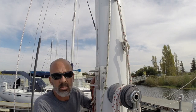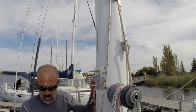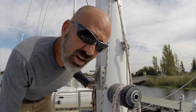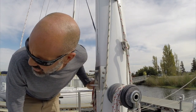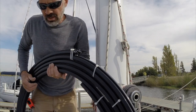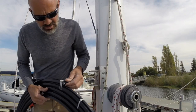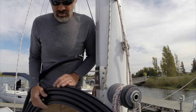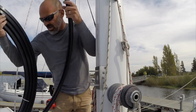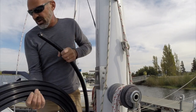To make this a little easier, I went ahead and pulled the gooseneck fitting and dropped the boom down onto the deck. Now we just have to cut the zip ties and start feeding it in — hopefully it fits. Here's the roller track; this is the top. It says snip a couple of zip ties and send this thing up, then cut them as you go.